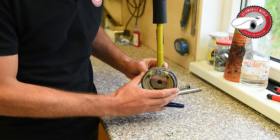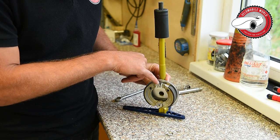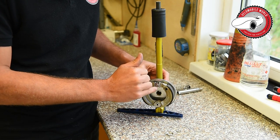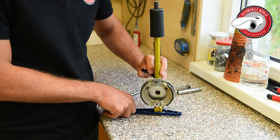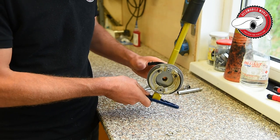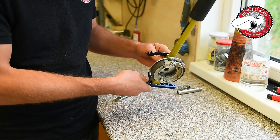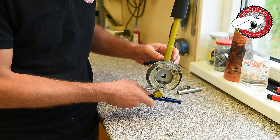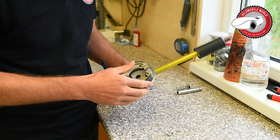Here we have some copper grease, because you get quite some heat, and normal vaseline might run out faster. But normal vaseline will also work. Put some vaseline there. If you see that it goes back slowly like that, then it's a good idea to grease this axle in here and take this off. So I will show you now.